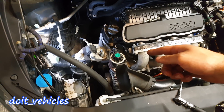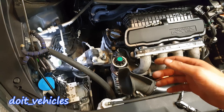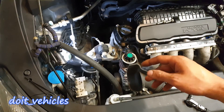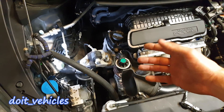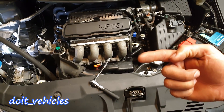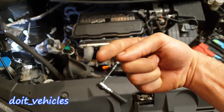It's also worth mentioning that this electronic EGR valve is much more durable compared to the type controlled by a solenoid and vacuum, which has a rubber membrane inside that often gets clogged up because rubber attracts more carbon buildup. Anyway, that was it. I hope this information is useful in your situation. If so, give this video a thumbs up, and until next time, take care — I'll see you soon.